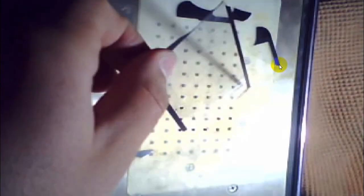The screen is completely unbroken and in great condition. We'll put another glass on it so everything is fine. Glass replacement is actually easier than full screen replacement — no worries at all. People may think it's dangerous and could damage the LCD, but it won't as long as you go under the glass directly. What you're holding is just the touch layer.